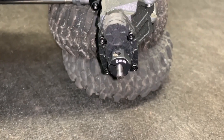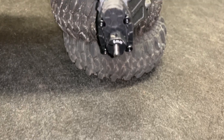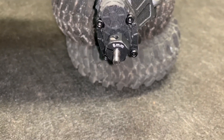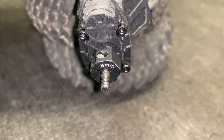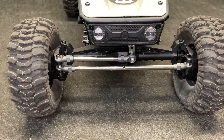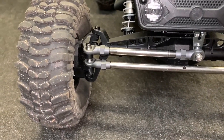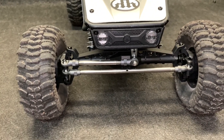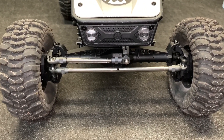The other possible fix would be wider wheel hexes. These are 8mm wheel hexes I got off eBay a while back and they fit just fine. They come with pins and a set screw and go right on. There's a link in the description for these wheel hexes, and they work, but they widen the track width up a little bit — and we really shouldn't be having this problem anyway.